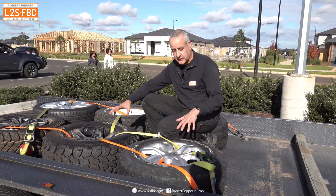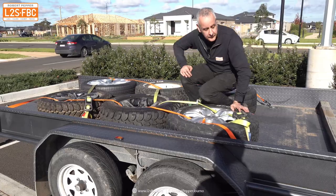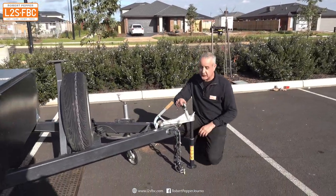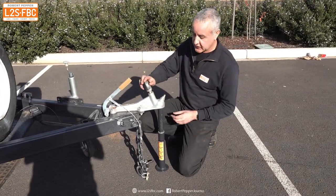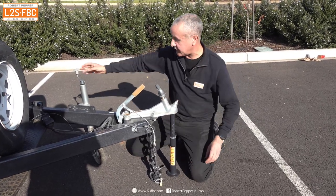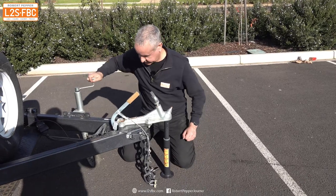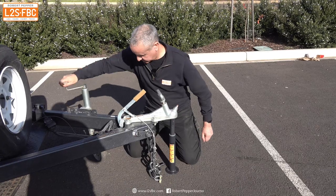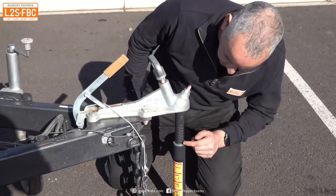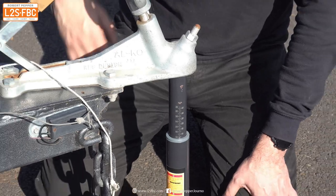Notice where I've placed the wheels — right over the trailer's axle — which gives a good stable tow. One problem with the Ioniq is its 100 kilogram tow ball mass limit, which isn't much. To get within limits, we push the tires back a bit. With the hitch off the ground, the scale reads about 95 kilograms of tow ball mass, which is within limits for the Ioniq to tow.